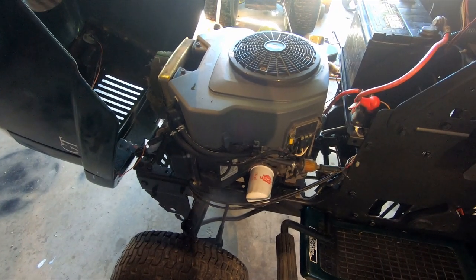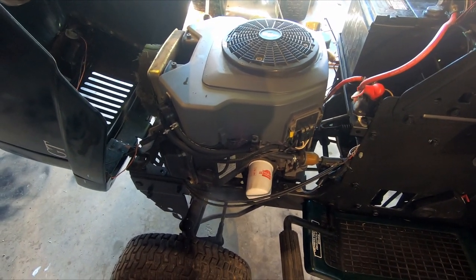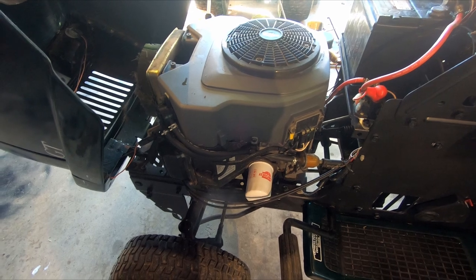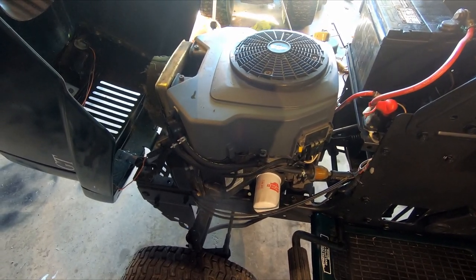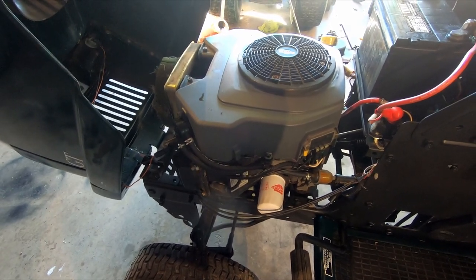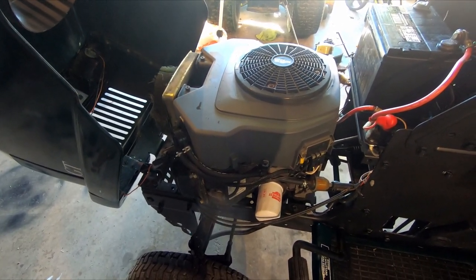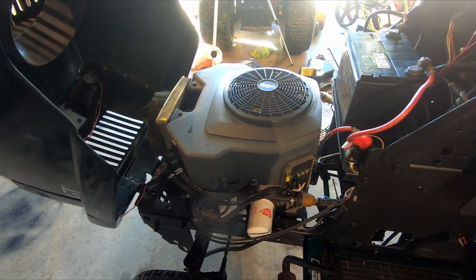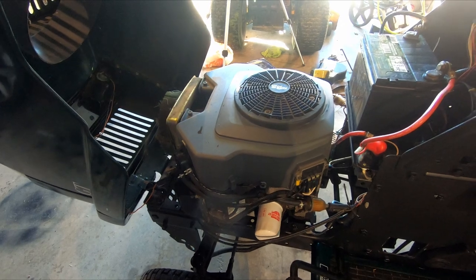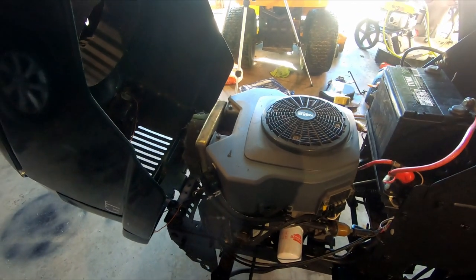I think that's a Honda oil filter size that I was able to put on there, so I didn't have to pay anything for the oil change. Oil was at the right level, but it was really black when I first started up. It was pretty tappy, which would make sense if it has hydraulic lifters. It does run really well now that the noise smoothed out. You rev this thing up, it sounds like a Harley V-twin.